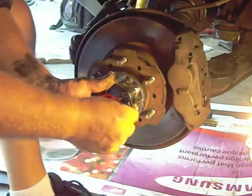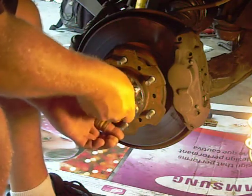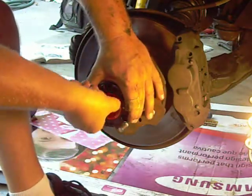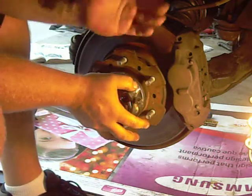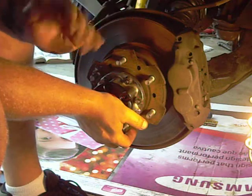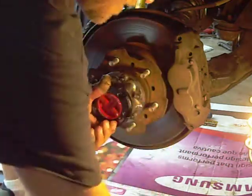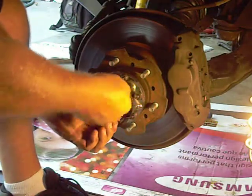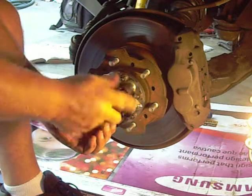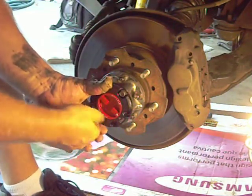Then I want to lock it — it goes smoothly to lock — and I hold it on tight while I turn the CV again. I can hear it's locked, and when I turn — hold the cover on and turn the hub — I can see the CV is turning back there. So it's in working condition. Everything's good. I want to start immediately getting a couple of bolts in. I want to turn it back to free before I do that. In the case of automatic locking hubs, even if you put the lock washers in, you go back a click and it'll unlock — you could even just roll an inch and it will unlock. Now the CVs are free from the locking hub. I know it's functioning how it's supposed to. These cover bolts are 10 millimeter — I'll use this tool to get two in for now so it'll stay in place.